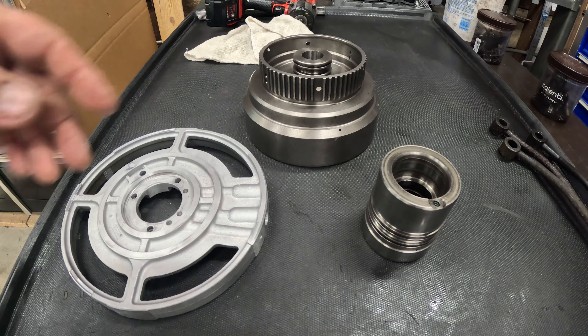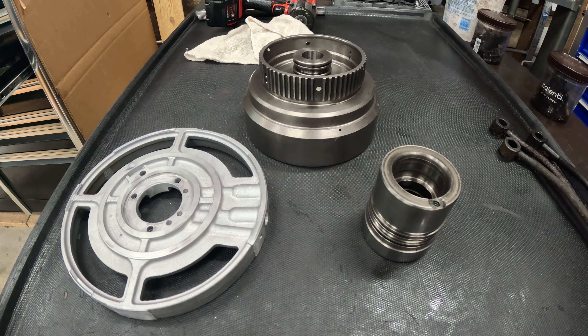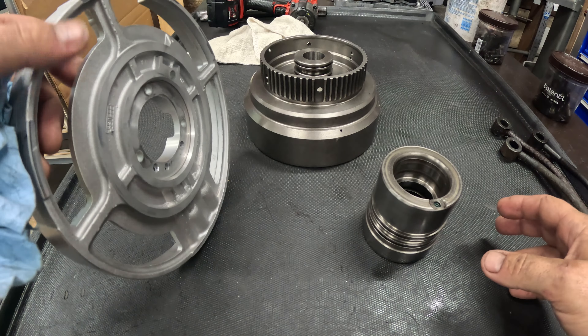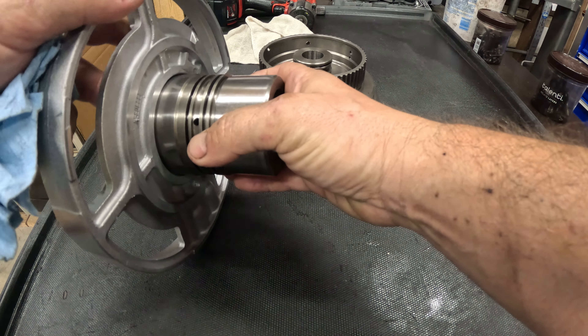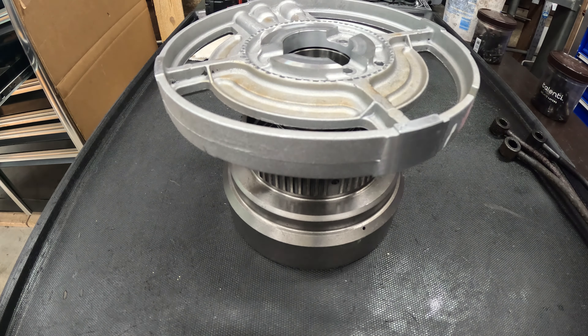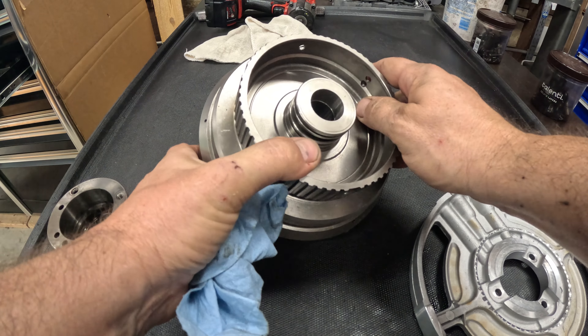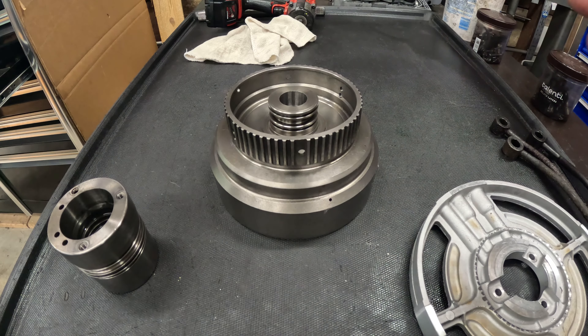Just in — I was tearing down another core and came across another forward drum with no splines. Before when I made this video I didn't have the rest of the parts, so I decided to add a clip and splice it in to show exactly what's going on. Normally you've got your center support and center support hub — they're usually bolted together. Inside the transmission it sits on top of the forward drum. The center shaft, which is hardened steel, passes through the hub and engages with the splines of the soft cast forward drum. Hardened steel versus soft cast — that makes a difference.